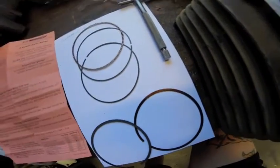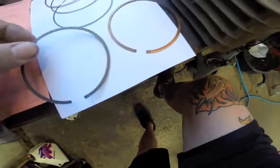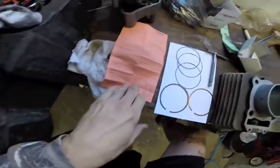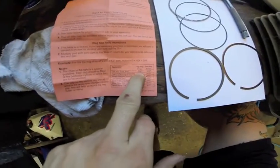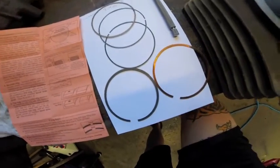So we have our rings laid out here. This is your oil ring — top and bottom. Then I believe this is your compression ring and this is your oil skirt ring. The second ring always has a larger ring gap, so you can tell them apart that way. Now this chart from Wiseco — pretty much how you measure what your ring end gap should be: for an ATV, you take the bore in inches — which is 2.910 — multiply by 40 ten-thousandths for the top ring clearance, and 50 ten-thousandths for the second ring.